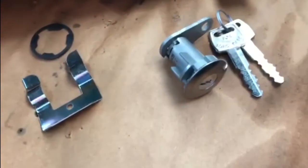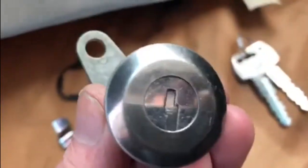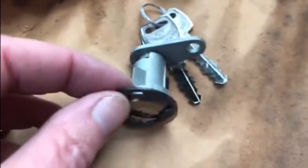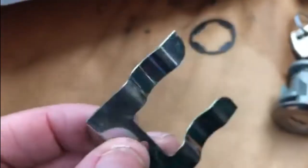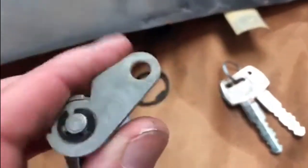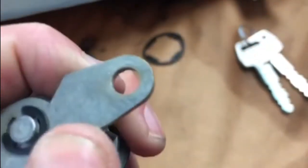As you can see there's no rubber gasket on there at all, but the lock is now out of the door. This is the bits for the new lock, but the lock itself which slides into the door — obviously that goes on the outside of the door — has a rubber gasket, very small, very thin rubber gasket which will go on the inside of that on this side. Then there's this clamp, very similar to a brake line clamp, that goes on as well just to help hold it in place, and of course the keys. Now where that hole is there, this is the bit that turns — you can see the motion of that as it turns. That hole there is where that rod goes through inside the door, so that's the old lock that came out.